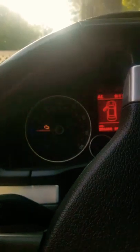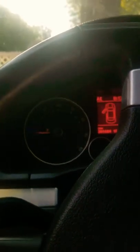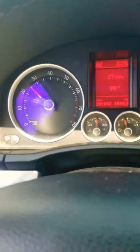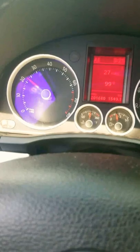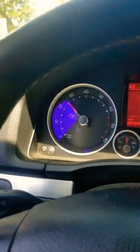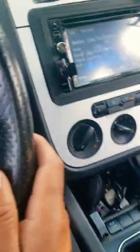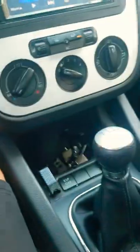But the check engine light remained. Like I say, sometimes when I drive it down the road the EPC light might come back on, and I will show you how I deal with it. So even though we have the check engine light on with the cold start code P0221, if the EPC light is not on, the car will still shift and act normal.